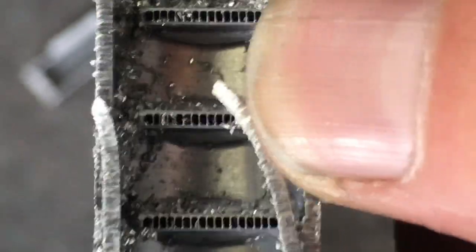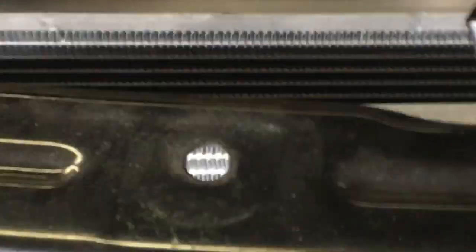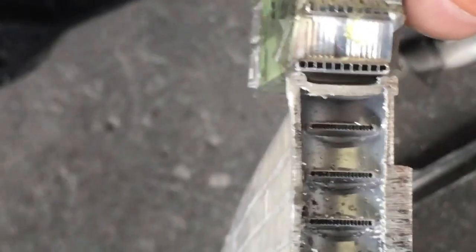Let's look at the entrance. You might see how small those tubes are. Here's a sample of those two — you see how small those are? Now here's a sample of some other tubes. The smaller the tubes and the more tubes you have, the more surface area, and the more heat you can dissipate. They cheated you again in this aftermarket condenser.